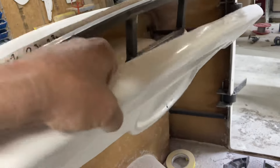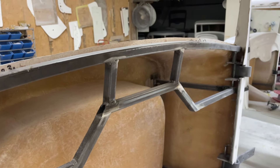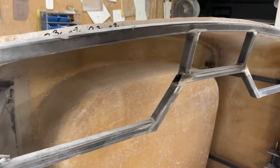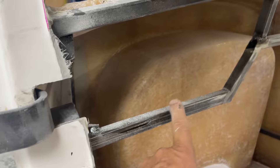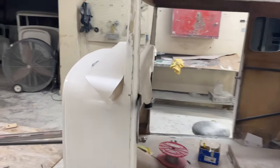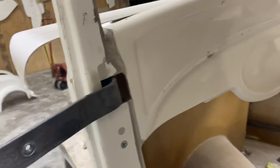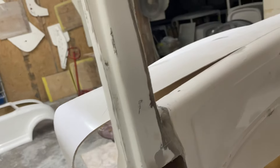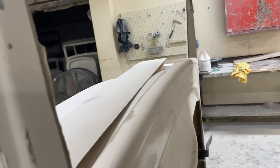This one we've trimmed out and pretty much have it ready to go in. Before it goes in, we have a metal framework in here so you've got everything you can hang your steering column on. What we do is bond that in here, bond it in down here along this area, and then once the dash is in, bond it in. It'll look like something like this. We haven't done any body work on here yet, but we'll do some body work around that edge and make it nice and clean — just bonded in. That's how the dash goes.